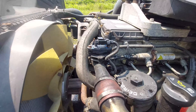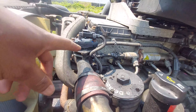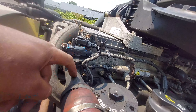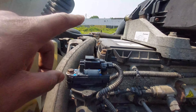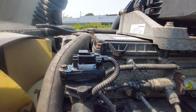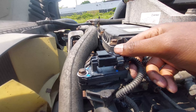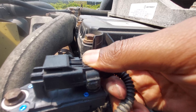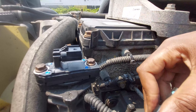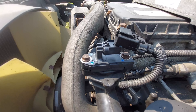I'm going to be taking out this EGR valve. First thing I need to do is take off the sensor. Instead of moving this hose, I'm going to see if I can just move this hose and keep this where it's at. Usually there's a little red lock right here that you push out, but I kind of broke that. After you push the red piece out, you push it out that way, hit this portion right here, push that down and it'll come out — just jiggle it a little bit. I got some 10 millimeters, one and two, to help move out this sensor.